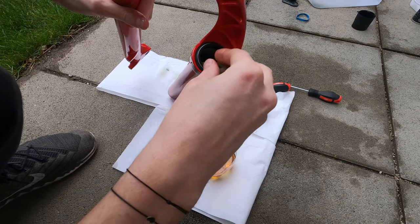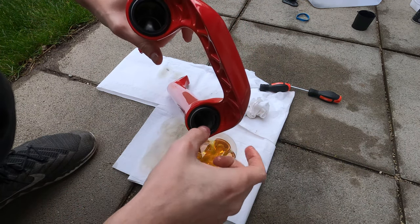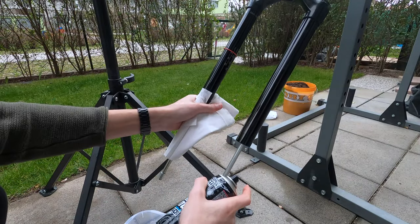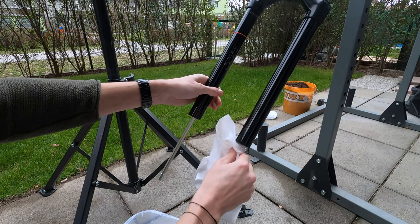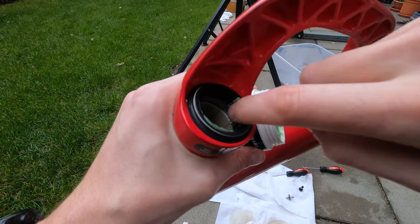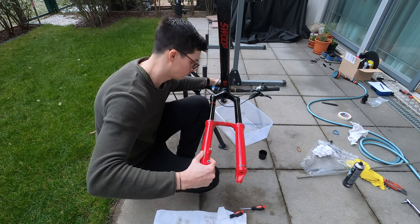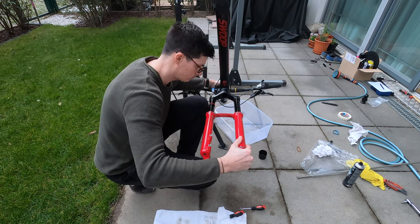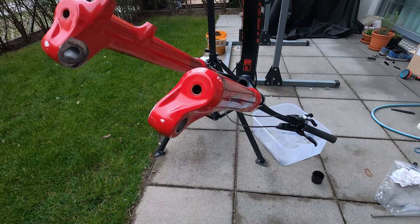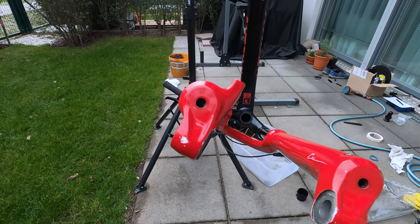You can now put the foam rings back inside under the wiper seals. Then it's time to reinstall the lower leg. First clean the upper tubes — I also cleaned the two shafts from oil residue. Put a generous amount of grease on the dust wiper seals. Then install the lower leg assembly onto the upper tubes and slide it just enough to engage the upper bushings with the upper tubes. Now rotate the bike with the fork oriented upward, and remember that the lower leg should not touch the shafts at this stage, as shown in the video.